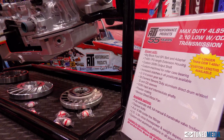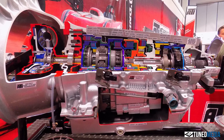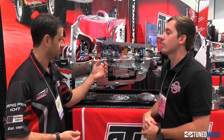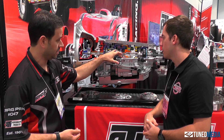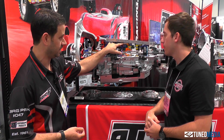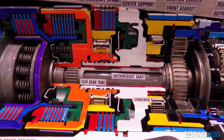This one's actually a six pinion, 210 low gear set, billet aluminum, four pinion on a reaction carrier, and we start out with a 300M output shaft. It goes through a Vasco gear set to a 300M main shaft. This was a new part for us as well — it's a billet aluminum high gear drum called the direct drum, and it's really critical because we made a steel sleeve so you have engine braking without trying to wear out aluminum all the time.